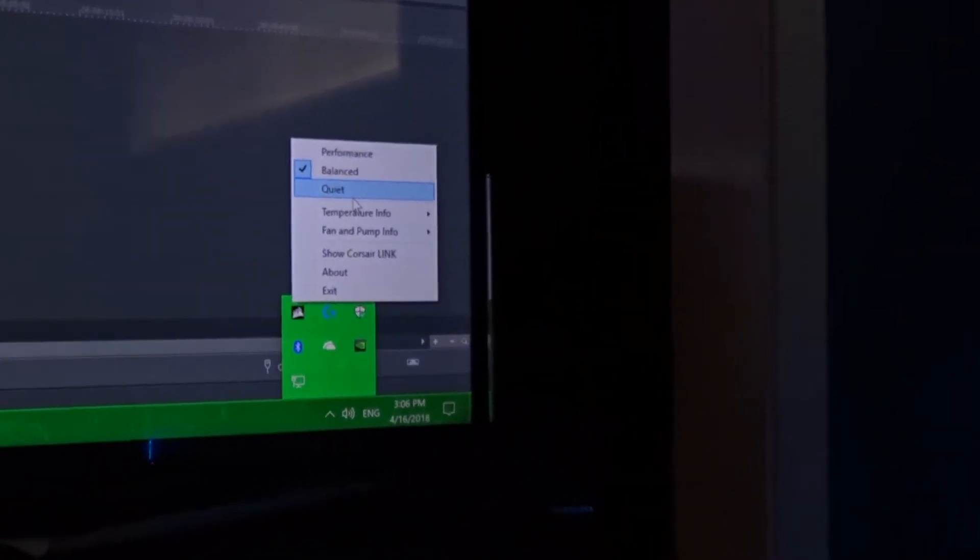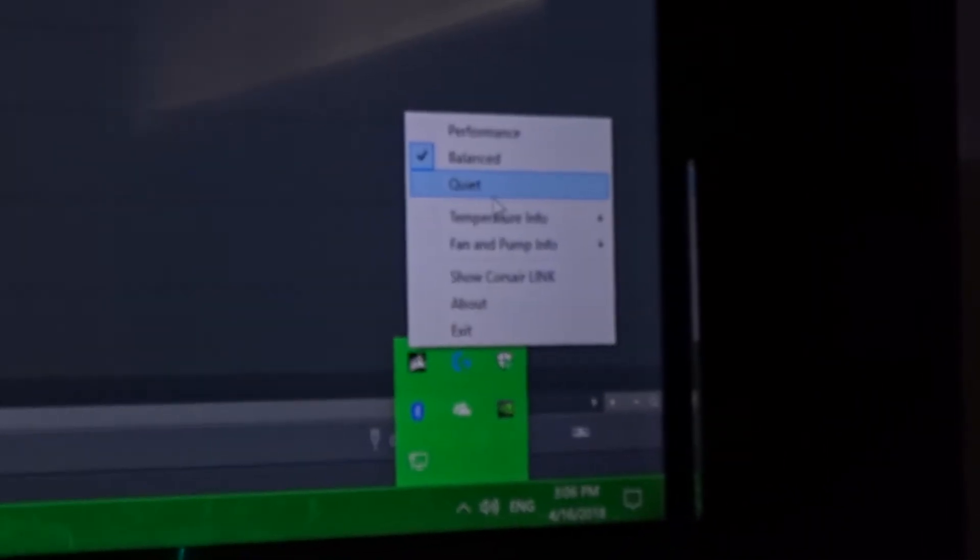I have two fans on the radiator. I tried to use Corsair Link to control my fans — I had it on quiet, but the fans were so loud. Then the CPU temperature got really high, so I messed with it a bit more and put it on performance, and the CPU temperature came down. The case fans weren't working in conjunction with the CPU fans and radiator through Corsair Link and the Commander Pro. So I re-managed the cables and put everything through the Corsair Commander Pro. Now the case, radiator, and CPU block are all linked up. The only RGB is the one RGB strip, and everything's running well.